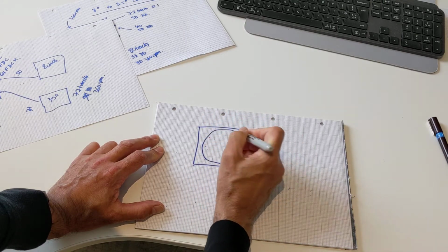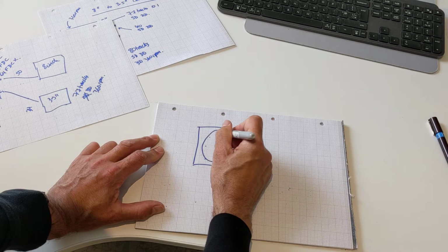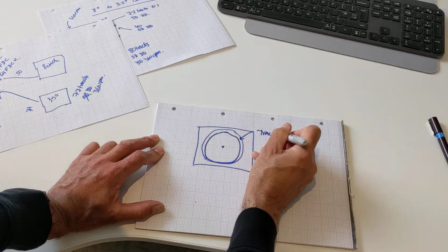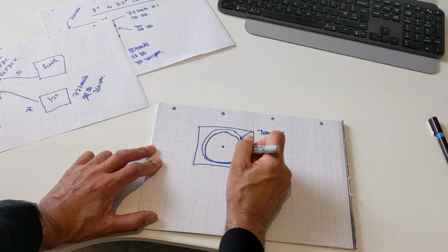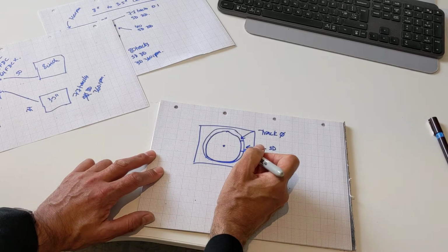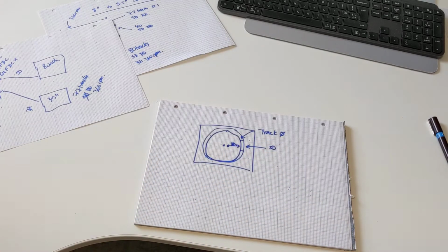Inside there's a diskette, and track 0 was on the outside. So, this is going to go horribly wrong, here we are. There's track 0, right on the outside. And they wrote that track single density. Even for a double density disk, they wrote the first track single density, and they wrote the rest of it double density. And unfortunately, most disk controllers or most software or archiving software just cannot cope with this fact.